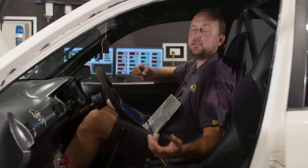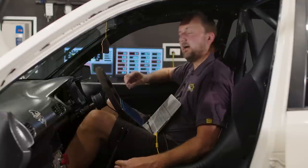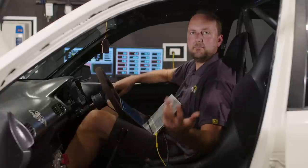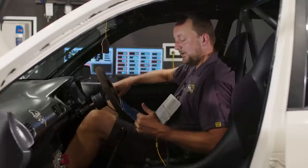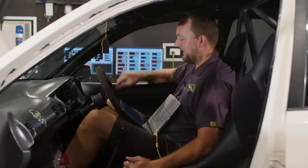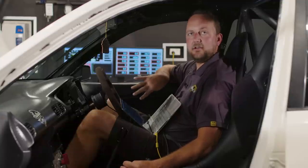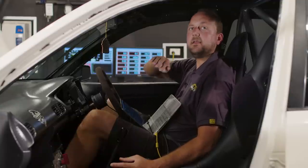I don't need to be in a particular fuel mode. So whether I'm in lambda or petrol AFR or methanol AFR or ethanol AFR or a mixture, instead, I'm going to simply look at what the short-term trim's doing. That tells me how far out that VE value is at any particular site. Then I'll rough that value in and keep going through.